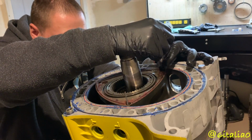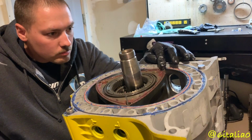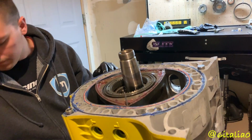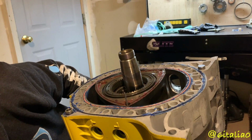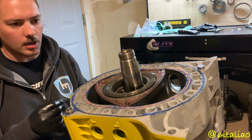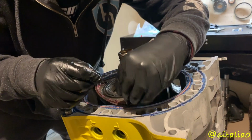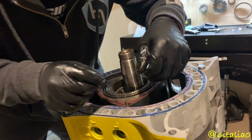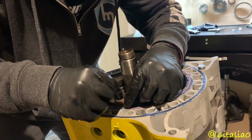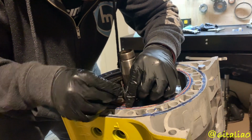But yeah, so you know, you're throwing that in there. I kind of want to see. We'd have pretty similar engines. The only difference would be, I would have the Series 5 rotating assembly, and you would have the RX-8 rotating assembly that's been balanced, and you have slightly better compression and less weight. Yep. And side clearance, so less likely to slap the irons at high RPM. Yeah, although I don't think I would take this motor up to crazy high RPM before getting it professionally balanced and clearanced like yours did. And if I did that, I probably wouldn't do it on this engine.